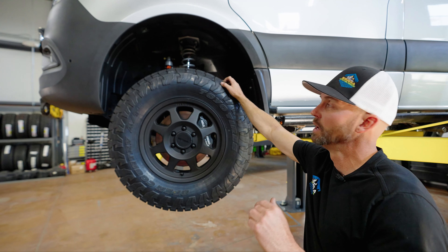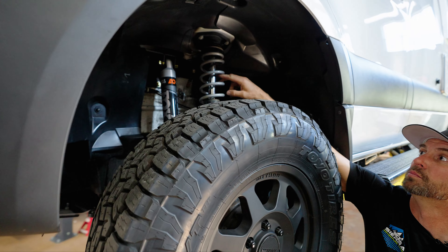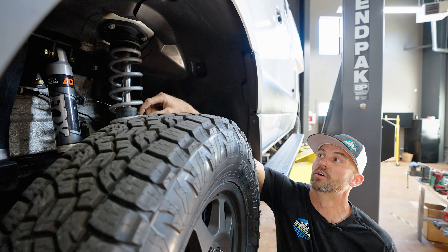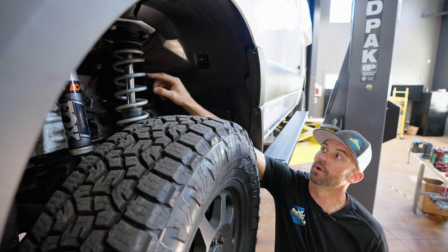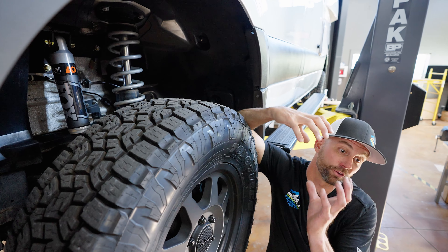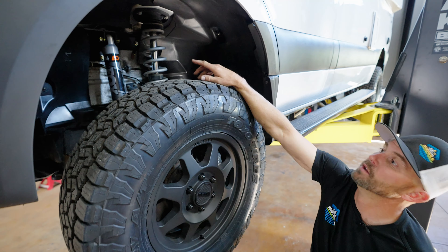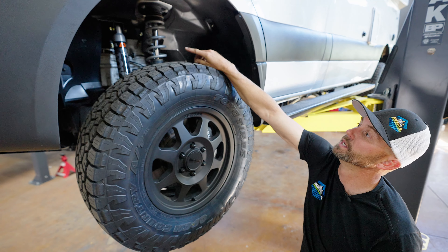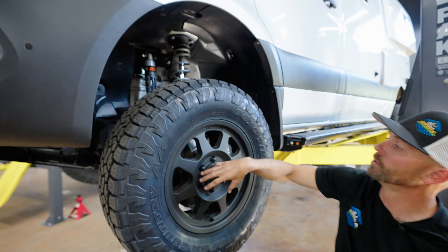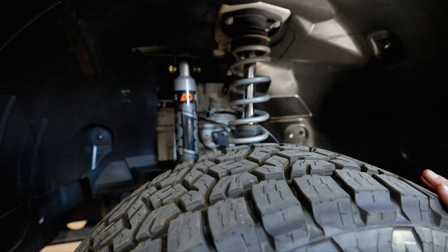The RIB kit does a couple things. The first thing it does is it adds a coilover. This Mercedes strut comes from the factory with just this shaft you see going into the body of the strut. This coilover with a plate up top and a collar on the bottom adds some spring rate and it also adds some height by pushing that control arm down a bit. And then to increase the dampening, there's a two-inch Fox shock added to the front of the Sprinter — that shock bracket, the lower control arm bracket, and this brand new two-inch Fox shock in there.